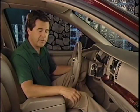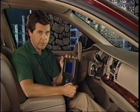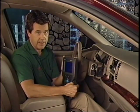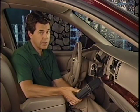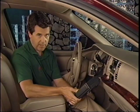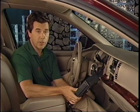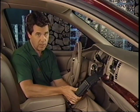The Tech2 can be used to diagnose the passkey security system. The Tech2 can also be used to program additional passkeys when no valid key is available. The Tech2 passkey programming method is also used on occasions when the passkey-coded key module or the PCM have been replaced. Connect a Tech2 to the vehicle. Access the passkey 3 menu and select the function that commands the PCM to learn a new key or establish a password for a new coded key module.